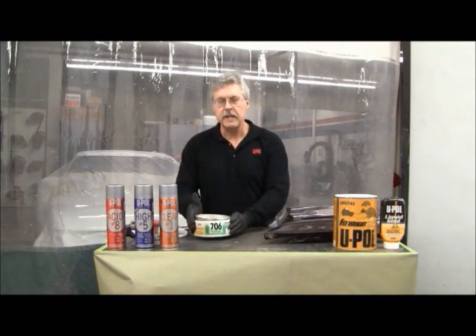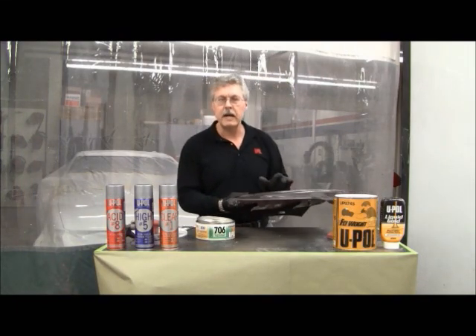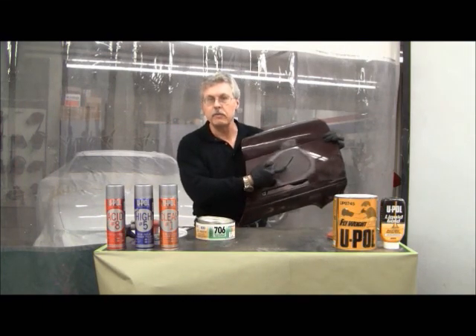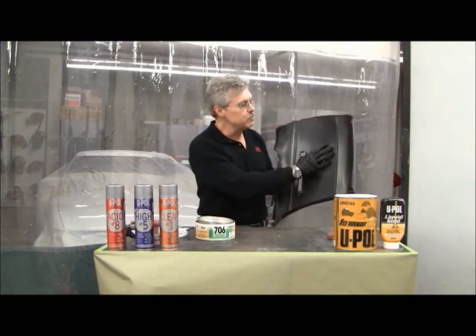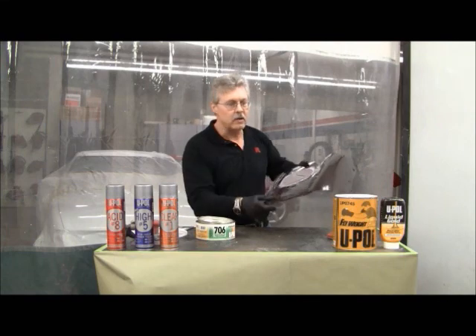This material is a flexible high-density filler that you can use for any kind of repair on a bumper cover — from light road abrasion gouging, deep road abrasion gouging, or even used for hole-through repairs with the use of reinforcement mesh on the back side. We can come to the back side of this material, use it in combination with reinforcement mesh, come around to the front side, and use it just exactly like body filler over metal.